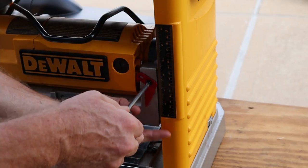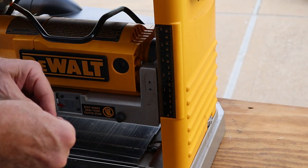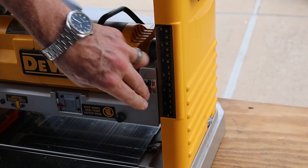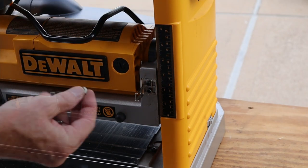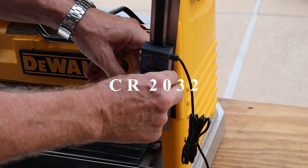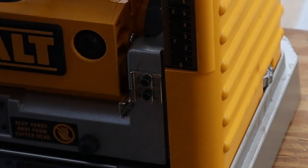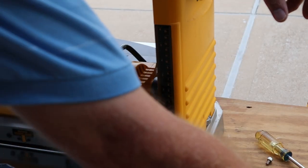The screws weren't rusted but they were well set in there. The bracket will mount here with the double washer and four-millimeter screw nuts — they're snug but not excessively tight, just enough that everything stays. Next we put the gauge itself on: the little hex nut goes in here. The cord can plug into an external battery source, but it comes with small hearing aid batteries.